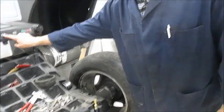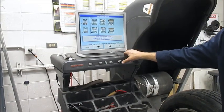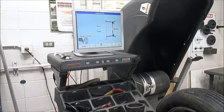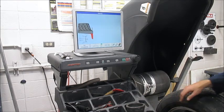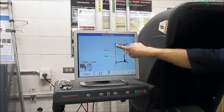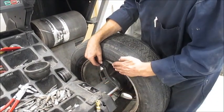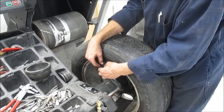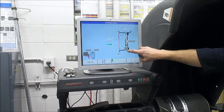I've selected my configuration for a hammer-on and a tape weight. Now we've got to tell the machine where we want to put the tape weight. See this special little arm here? All I'm going to do is grab it and slide it out a little. The machine chirps and flashes saying, 'Where do you want to put the hammer-on weight?' I bring it out because there's a certain distance from the machine to the wheel, and it helps with calibration and calculation of the right amount of weight. I've got the little arm touching the wheel and I'm going to pump the pedal. Now it's flashing over here saying, 'Where do you want to put this weight?'